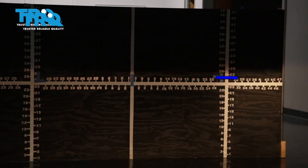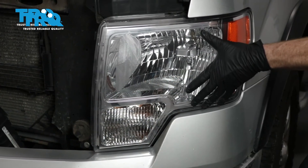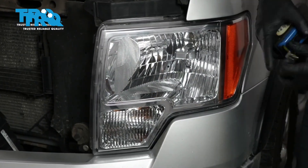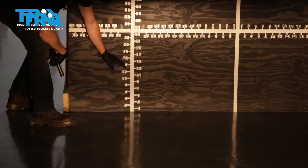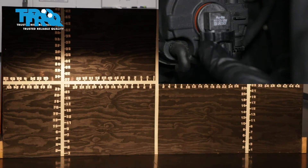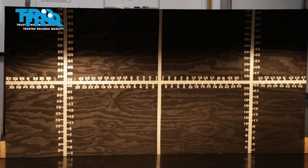Let's continue on to doing the passenger side. We've properly aligned our TRQ headlamp assemblies. On the quality TRQ headlamps for a pickup truck, the procedure is going to be the same — you're going to find your center dot, mark it, and then measure from the level ground up to your dot. So once your headlamps are properly adjusted, it'll be time to adjust your fog lamps. You'll notice on the driver's side the focal point is all the way at the bottom right now. I would like to bring it up so it meets approximately the bottom of the focal point of the headlight. Some fog lamps have an adjuster, others don't. The ones that do have an adjuster, you would just turn the adjustment to the left or to the right to adjust the beam up and down to where it needs to be. With your TRQ headlamps and fog lamps properly aligned, you can drive down the road safely.